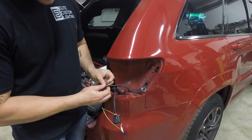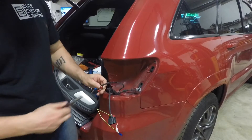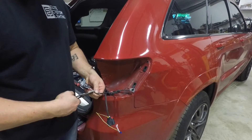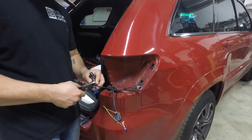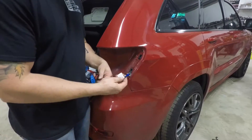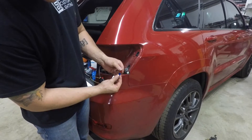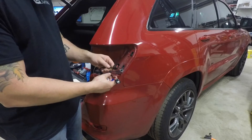Take the vampire clip and place it around the wire with the metal piece around the wire, then close it up. Pinch it with your fingers — it probably won't go all the way through, so use pliers. Place the pliers right on there, give it a squeeze until you hear it click, then pump it a little more to make sure the metal piece has cut into the wire, which makes a solid connection. Once that's done, take the running light wire and plug it straight in — make sure the piece inside goes all the way in and doesn't sit on top or bottom, otherwise you won't have a good connection. Press until it clicks and you're ready to put on the tail light.